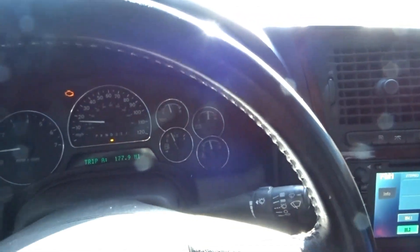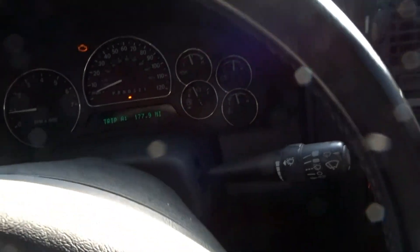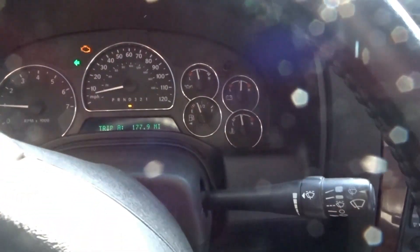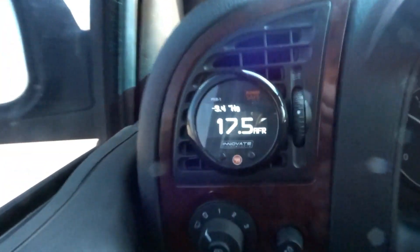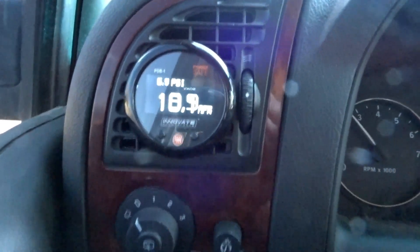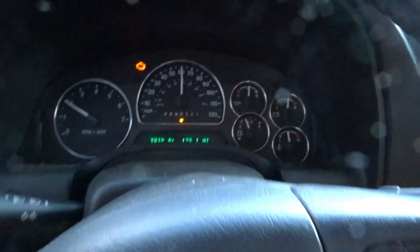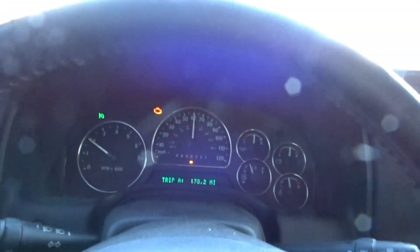We're just driving in my supercharged 97x. The tune is getting close — it's still a little rich, but getting closer. Hopefully I can get that done after a couple more logs. It's hard to send logs to him because I'm working all day and he's off at 5 PM Central time. I want to show you — it's not very fast yet — but we'll make some boost. You can see it's pretty lean still, but you can see how much boost it makes — boost builds super easy, which is pretty cool. I think peak on that run was 6.8 pounds.